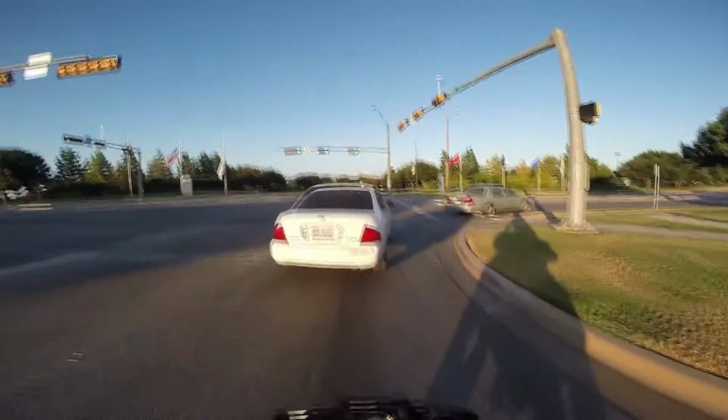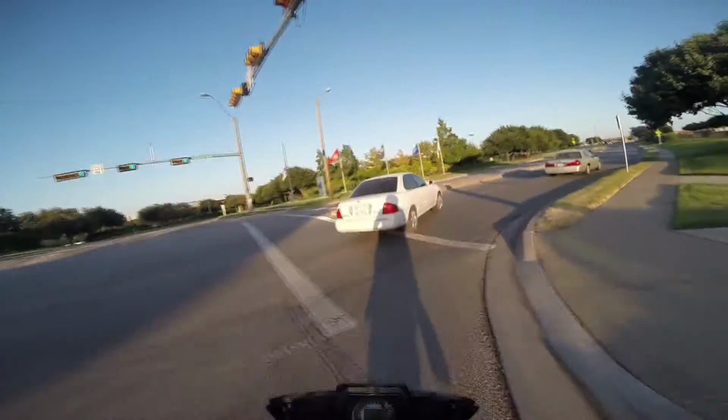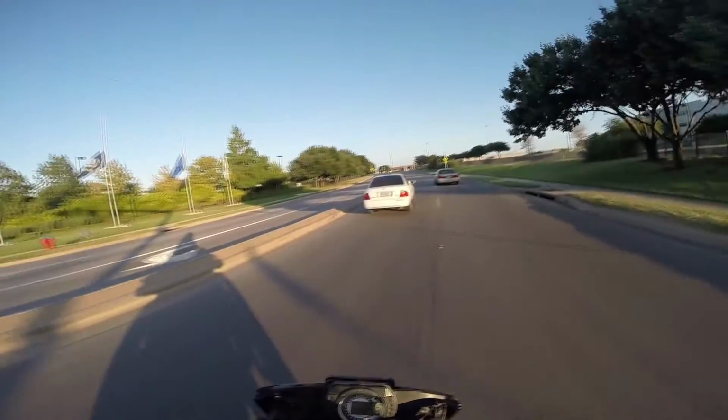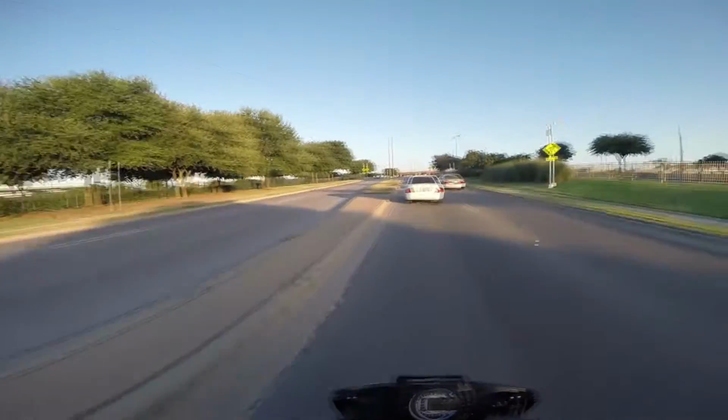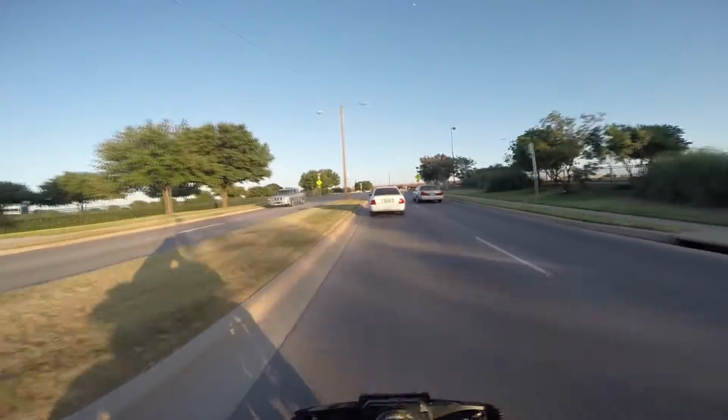It's maybe not as grabby as I like, but it might be this master cylinder, because there's a little bit of tightness there. I was trying to work that out when I was going through this bike, and maybe I just never quite worked it out all the way.